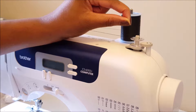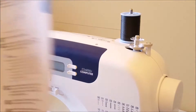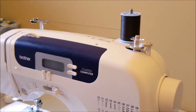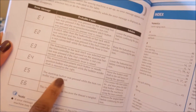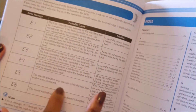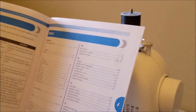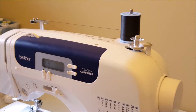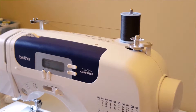It gave me an error — E5. I don't know what that means, so I went to my trusted manual. At the error messages section at the back, I found the E5 error message. It says the start/stop button was pressed while the foot controller was connected. It tells me to disconnect the foot controller and press the start button, or otherwise operate the machine using the foot controller.